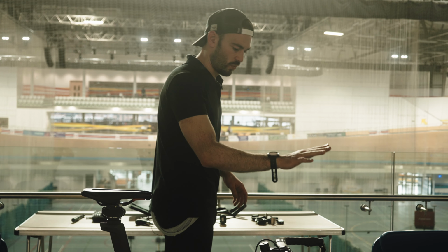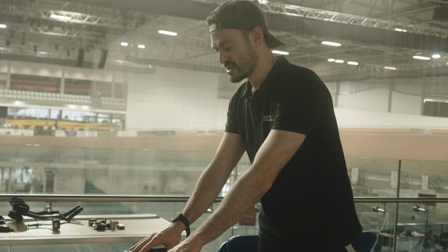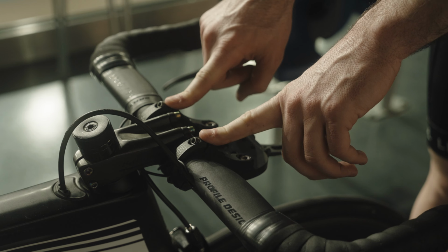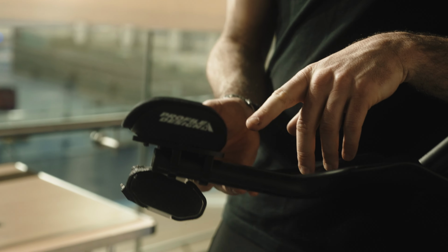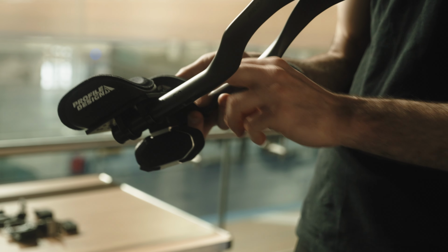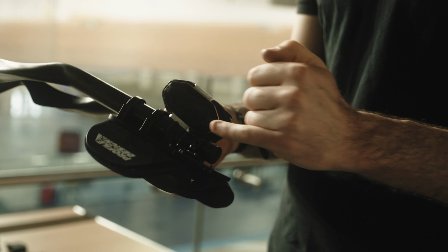Moving on next, very similar to the saddle, it's the same load cell really, in essence. We put the handlebar sensor, which replaces the mono or dual riser on your time trial bike or TT bike. This is actually a standard 31.8 base bar. If you have a system like this, we supply some clamps that bolt onto the 31.8 round tubes, and they go into a Body Rocket plate straight onto our sensor. Again, the load cell itself is 5.5 Newton meters. You have adjustability in the stack and reach here. This also rotates round, and you've got fore and aft underneath and above here, so it's a flat plate. And whatever bars you have, we will supply the right hole spacing underneath.